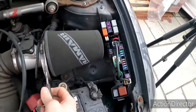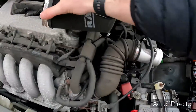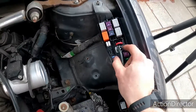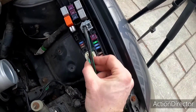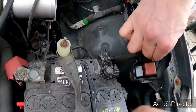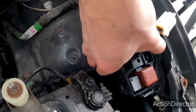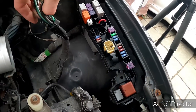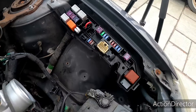I just needed to crack that loose and then we can get the air filter out of the way. So that gives us a nice big area to work with. You want to unclip that one - that one just unclips. Squeeze that in, pull that one out of the way, and there's a thumb tab down there on that one so you need to squeeze that one together and pull that cable out. Then these two little tabs - pull them away and pull the whole unit up in one go. That entire loom comes away from your fuse box. Just move it up and out of the way, and there you've got access to your fuse box.